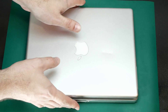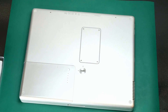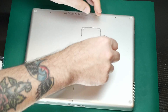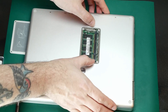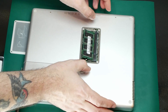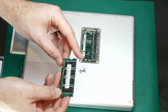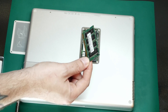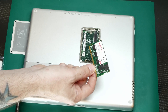Why don't we start with the easy task and upgrade the memory first. The memory is just four small Phillips-head screws away. And then let's see what we have in here. This is just a 512-megabyte PC2700 from Samsung, which we will swap out with our 1-gigabyte memory module.